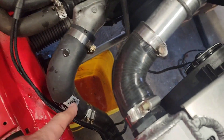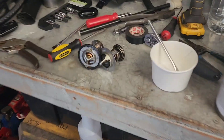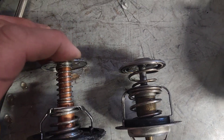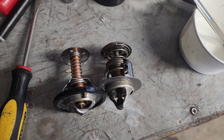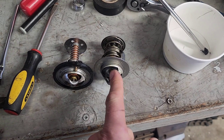Next day, down in the garage. As you can hear in the background, the thermostat is out. Surprisingly I thought I was going to lose more coolant than that. This is what I was saying — the thermostat didn't open, and now I know why. Your boy put the wrong one in. Look how much longer that is — this thing was fully compressed and couldn't open because it was already open. I don't know, maybe this is for a truck or something. I'm going to throw the old thermostat back in. I don't really have too much time to work on it today.